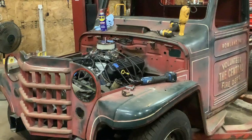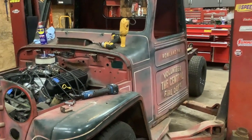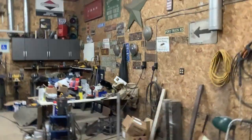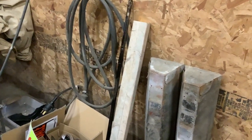So yeah, that's where I am. Bunch of parts. Cut her down. Made the mounts for the rear. Got to do four more mounts. This is just mocking it up. Still going to try to figure out what his seat height is for his ride height so I can mount the steering wheel. I can use his original steering wheel. The shaft is over here — I'll just cut it down and put the U-joint on the end of it.